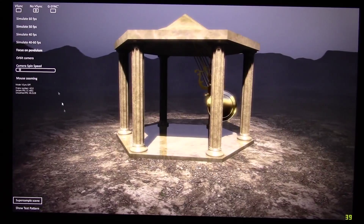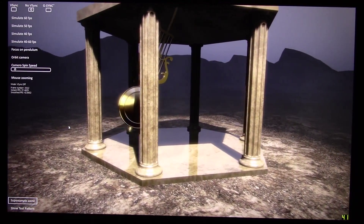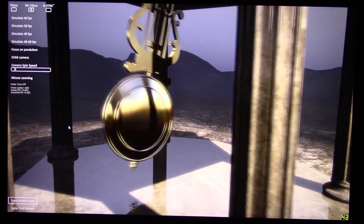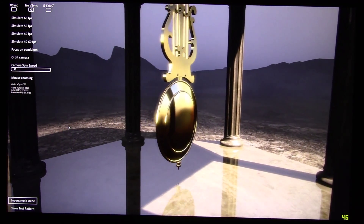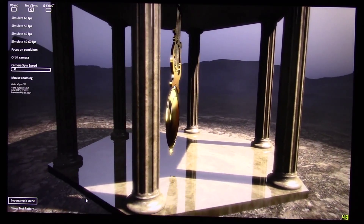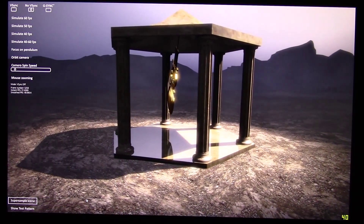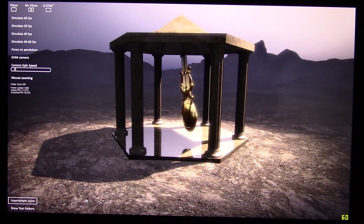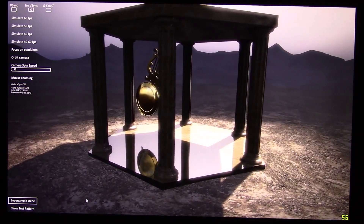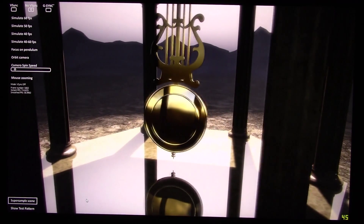So basically, what is G-SYNC? G-SYNC syncs every frame regardless of what the frame rate is, which basically eliminates any of that tearing and stuttering that you typically see. What do you need to get G-SYNC in a laptop? Well, there are a select few laptops that have it. The Sager NP9773 is one of them, but it requires an NVIDIA video card that is G-SYNC approved or enabled, and it requires a G-SYNC license embedded in the laptop, as well as an LCD that is also G-SYNC approved.